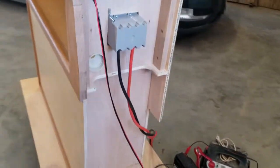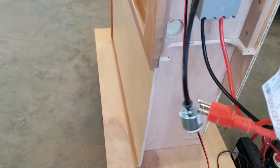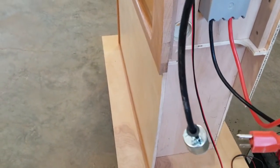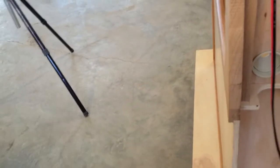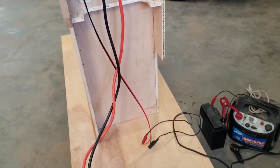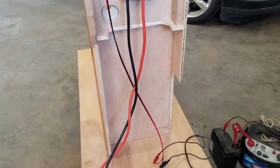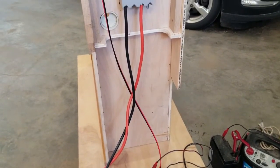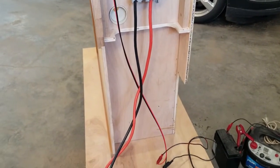About what's going on in the back with the power: I've got two different plugs. The inverter goes to the orange one. I need to create the outlet that'll plug in here, but all of it gets hidden inside the cabinet back there. That 12-volt will connect to what I've figured as a master switch that'll kill all the lights by flicking one switch off, and then each individual light is also switched.